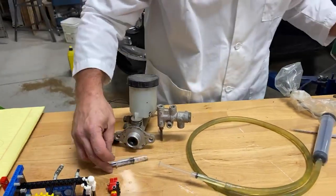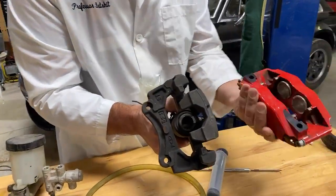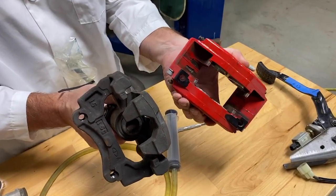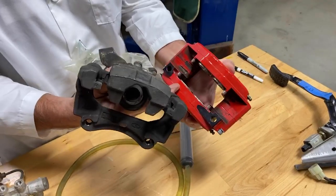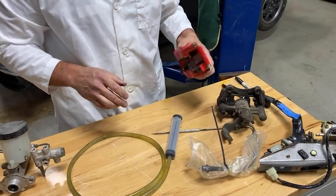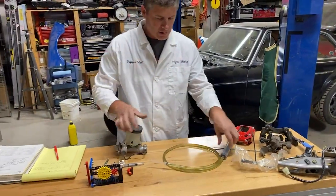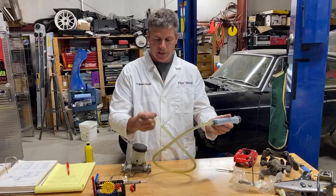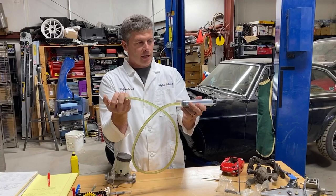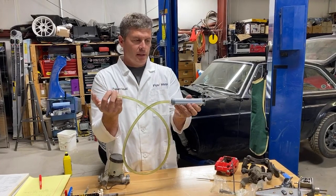On the other end, in a caliper, you've got pistons as well. This four-piston caliper's pistons are basically just like the master cylinder but turned around — put fluid in one side and they push out in their bore. That's the fundamentals: a lever pushing on a master cylinder, pushing fluid to your brakes. The master cylinder is small and the brakes are big, so you get a lot of travel geared down into a setup that puts massive force into your brake pads.